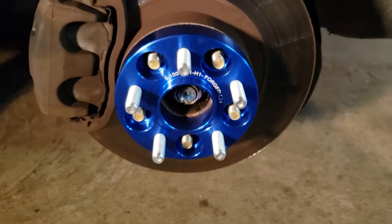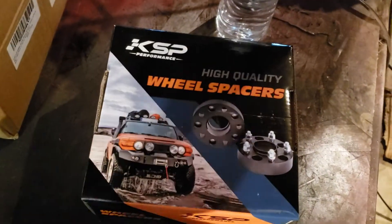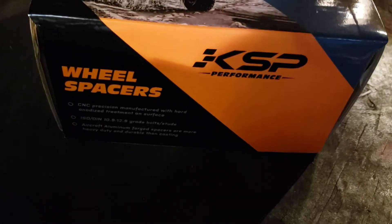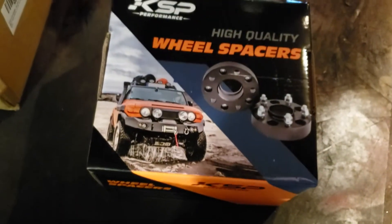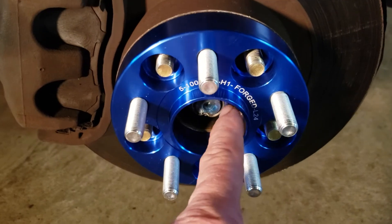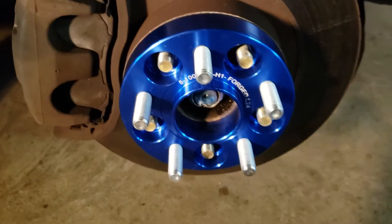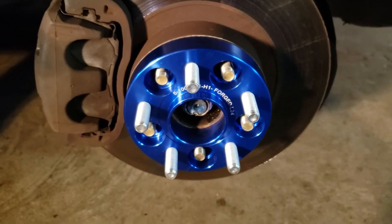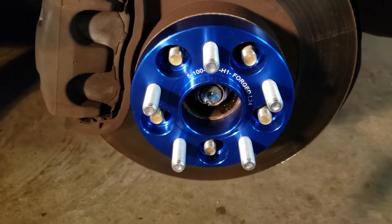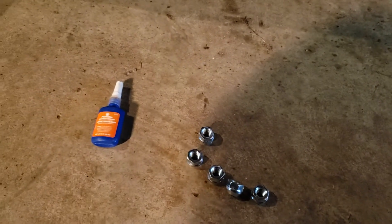First impression of KSP Products — this is the box I showed in the last video. He ordered them online. So far so good, I'm impressed. I didn't have to do any modification — sometimes this hub area will be too tight and you have to remove material, which is not good because you'll never get it centered again unless you put it on a lathe. If you have to sand or grind any material out, it'll still fit but it won't be centered properly.